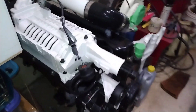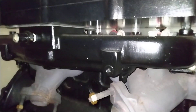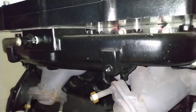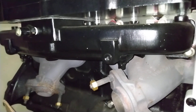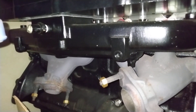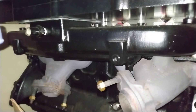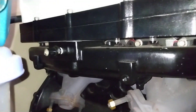There are several different ways you can supercharge, but what I used was a Clifford intake manifold — one with water heat. With the injectors where I have them, I didn't really need to use the heat. I've done several carbureted sixes without heat in E85, and with the fuel entering the plenum that's an issue at idle, but with the injectors close to the ports there's enough velocity that the heat was not used — but it was all set up and ready to go in case we needed it.